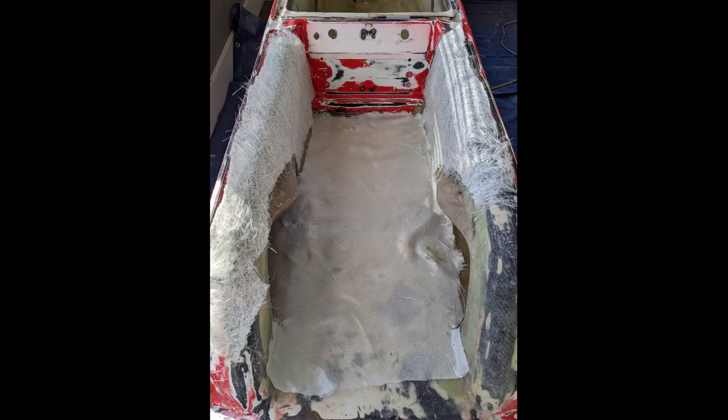The parts that you need to pay most attention to are the corners. You want to actually overlap the corners. So you'd kind of take the flat part from the bottom of the tray and round it upwards to go up the sidewall. And when you do those rounding of corners, you want to make sure there's no air pockets. It's actually kind of hard to do round surfaces without getting air in between, so make sure you look out for those air pockets. Spend a lot of time making it waterproof. You don't want any leaks.